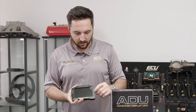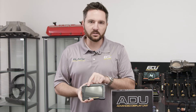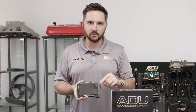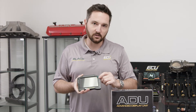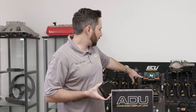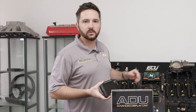The neat thing too — in this housing you've got 15 programmable LEDs. I'll always do a progressive shift light up top and then use the ones on the side as warnings or indicators. You can use one of these lights to flash for turn signals, or you can have icons on the actual dash layout like a check engine light or battery light indicator. There's no separate street version because you can make the layout whatever you want.